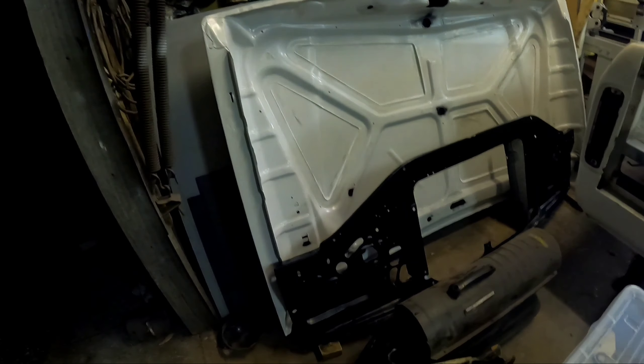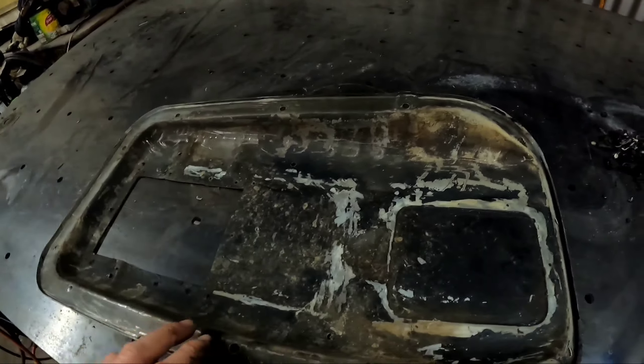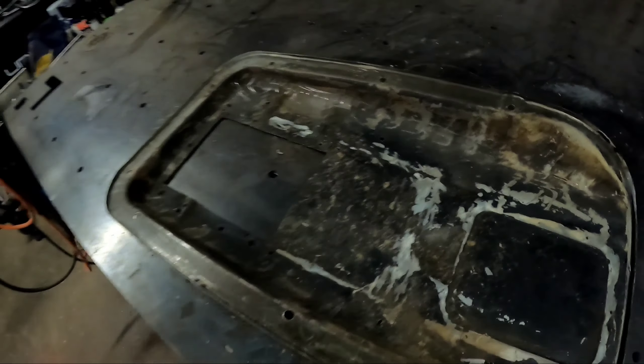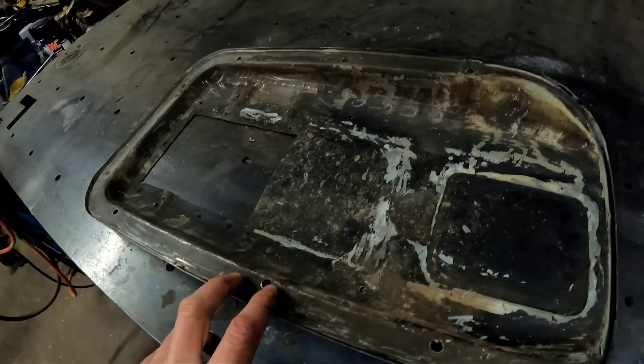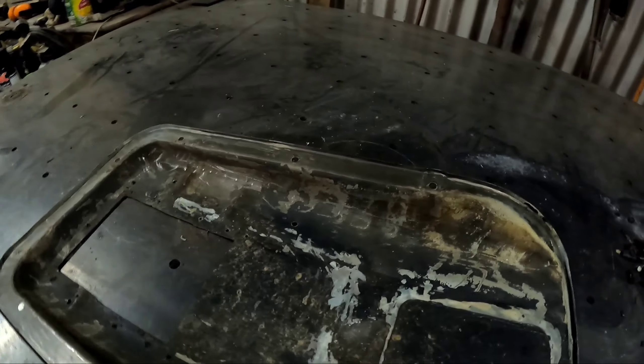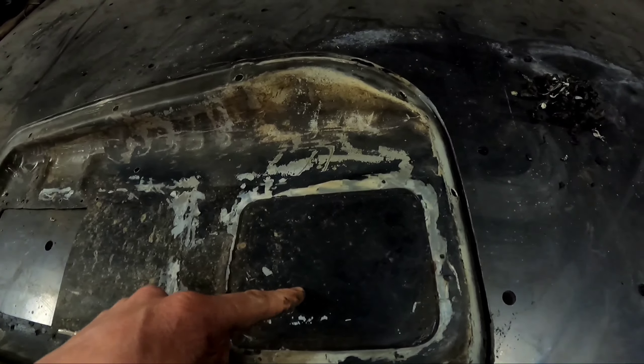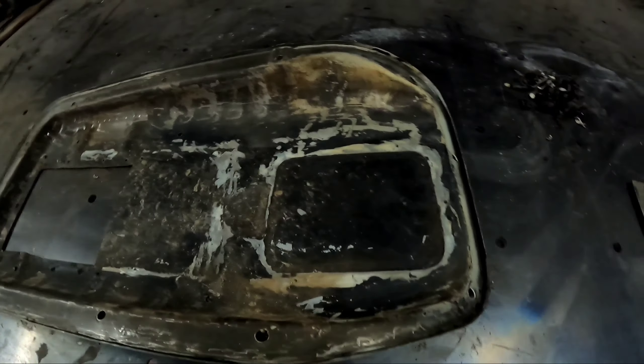The radio panel's there, pretty much ready to go. So tonight's job is I'm currently working on this transmission cover — this is the one out of that truck there, as you can see by the 50mm shifter holes. What I'm doing is using this one in the tow truck, and the one in the tow truck is good on one side, and it's that side I'm going to chop off and join to the one that's on the floor. The reason I'm using this one is it's still got the hole for the original 4-speed, and that's what I'm going to be using for the tow truck.